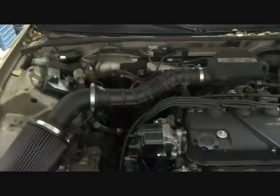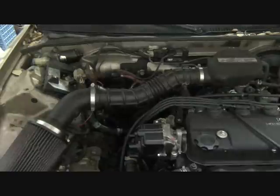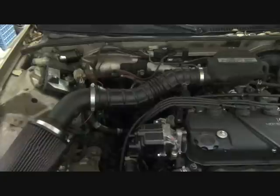You can kind of look and see and be reminded on some of them. Some of them are out of sight, out of mind kind of thing. So be mindful as you're putting things back together of what else there is that you might be forgetting. Also, you don't want to forget to refill the transaxle with new fluid. Takes 1.9 quarts on this particular model. And also, we'll need to adjust the clutch, and we'll talk about that in greater detail a little bit later.